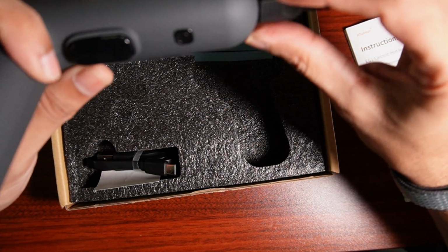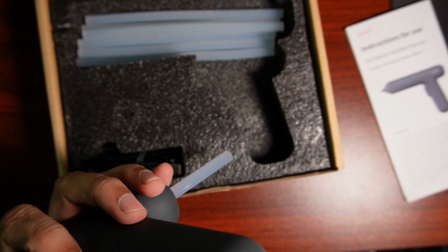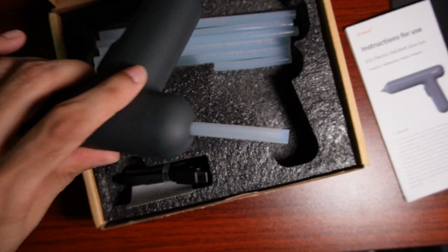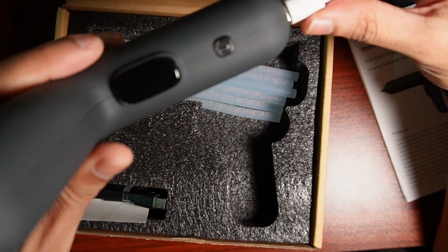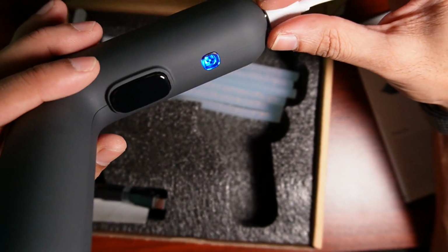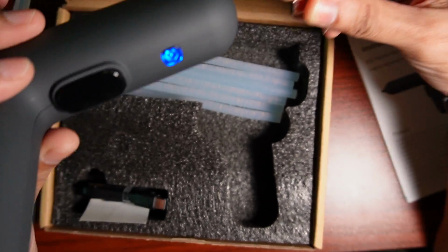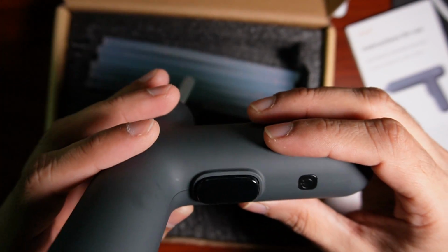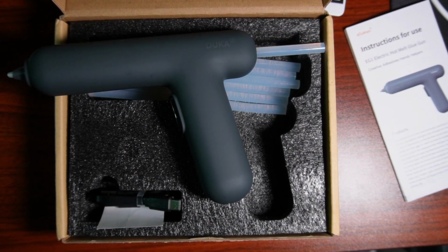The build is nice, and the Type C charging. I think it needs the regular Type C, meaning not the power delivery. I don't think it has the chip or the resistor needed to get it charged from Type C. It needs a normal 5-volt Type C, but that's it. It charges in 1 or 2 hours, with a normal slow charger, but it lasts quite some time. I charged only once. After getting it, I finished 2 sticks already.